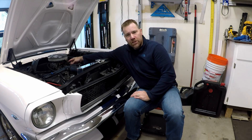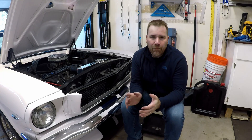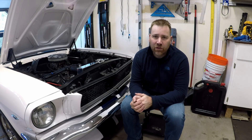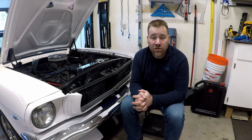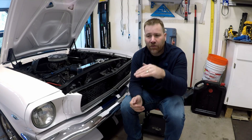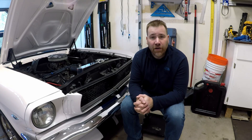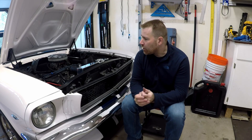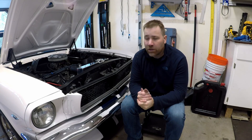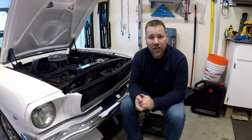I did back down the idle mixer screws just to make sure those things are happy. We're using the middle position on the pump. There's a lot more you can do — when you're digging into this stuff you're going to have to do some research. I'm just scratching the surface of what I can do with this carb. I just wanted to get to a spot where I could take it from here and tune up or down using that 1405 chart instead of this 1406 chart. We'll call that a win now that I got that clog out of the jet. Thanks for sticking with me — we'll see you in the next one.